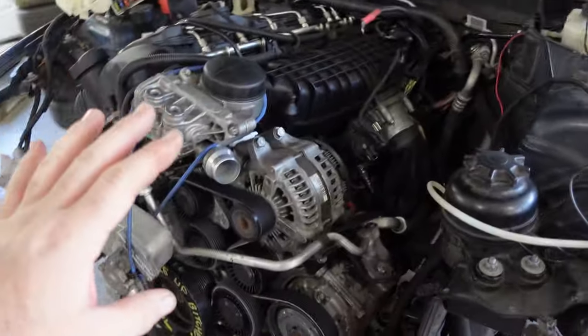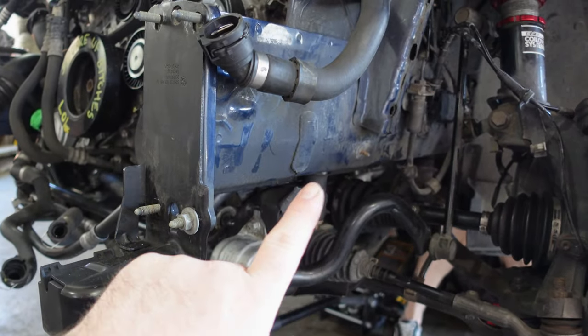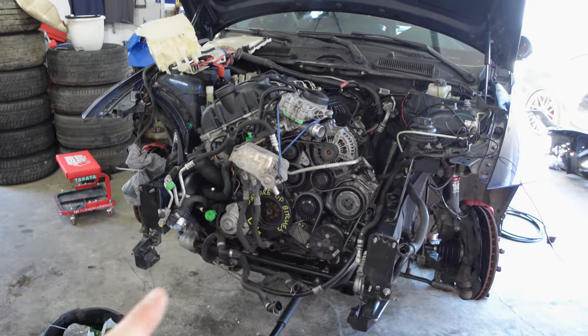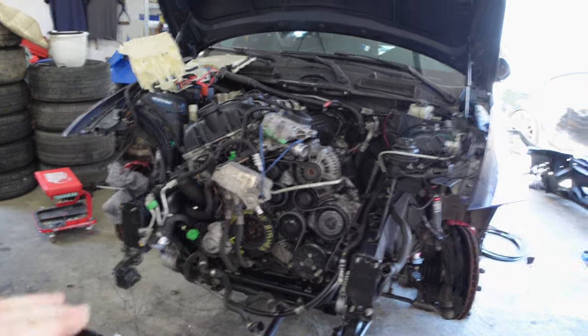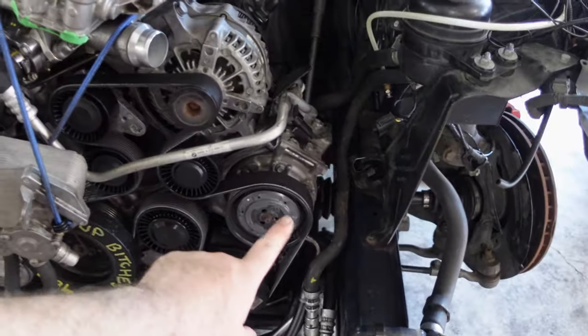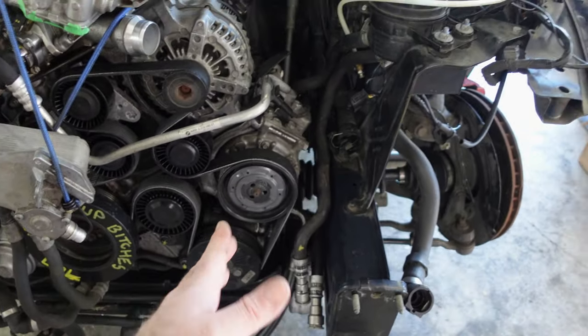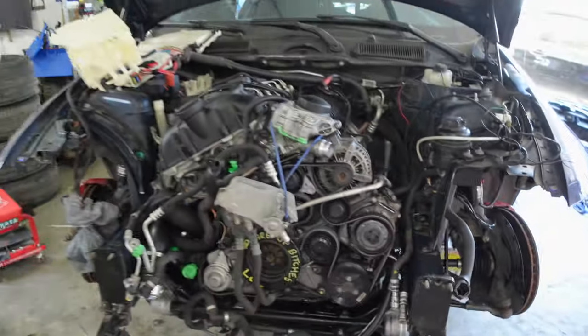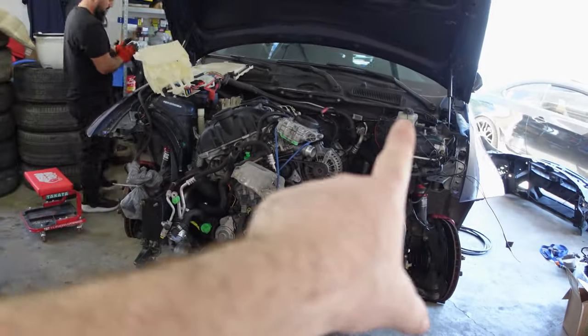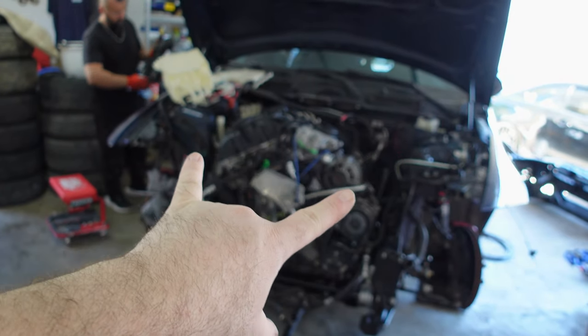Taylor's underneath. For the engine itself, what we ended up doing is the subframe bolts. So you have the 18 mil. There's one here, one about here, and one there-ish. We lowered the six of those bolts. The entire subframe drops down. The easiest way is to put the engine and transmission onto the subframe, and then you lift it up into the engine bay. The one thing that we could have done that would have made life a little bit easier is leave the AC and the power steering off so that we had a little bit more room up and through here. But it really doesn't look all that bad. And we connected the brakes on both sides, struts on top with the 3 13 mil nuts. And we still have quite a bit left to do.